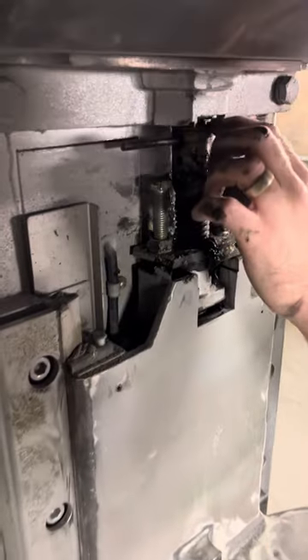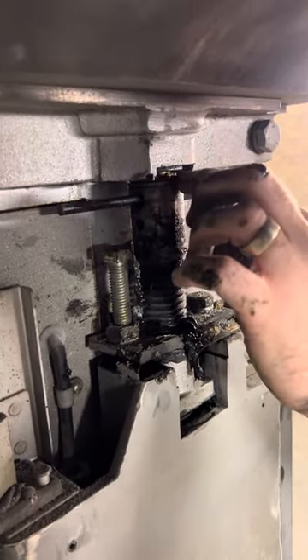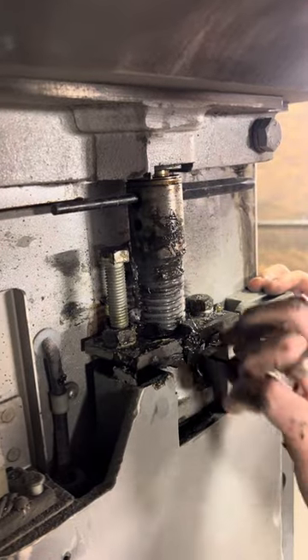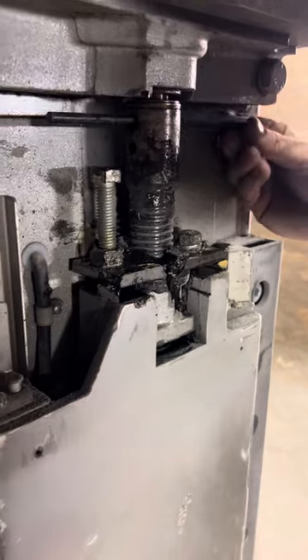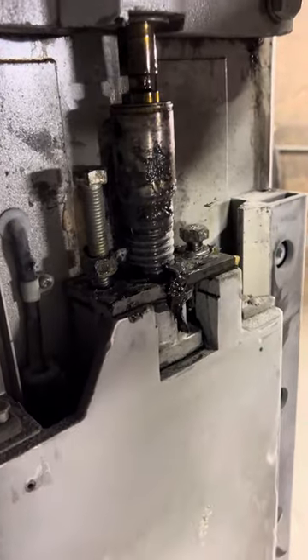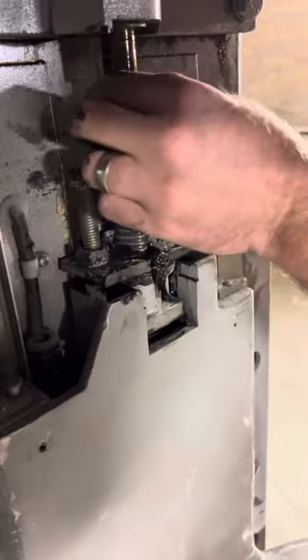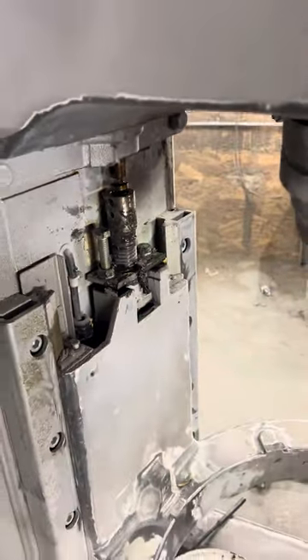When we drop this, you're going to have a thrust bearing set here — there's two plates and a needle bearing. We need to make sure we don't lose those. If you have someone close by, they can give you a hand here, which is much more helpful. So we're going to lift up on this, take the punch out, and we have a bucket here that's going to end up catching this once we drop this all the way down.